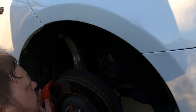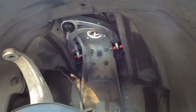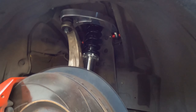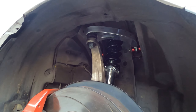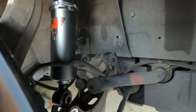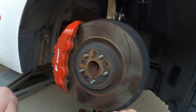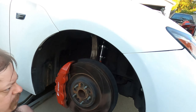For the coilover install, we have the new camber arms in — that's a separate video — and we're going to pop the new coilover in. The coilover is mounted at the top. We still need to do the bottom bolt. We're bolting in the new camber arm first, then we'll do the bottom bolt and sway bar end link, tighten everything down, and then start adjusting for height using the center point on the hub as a rough estimate.